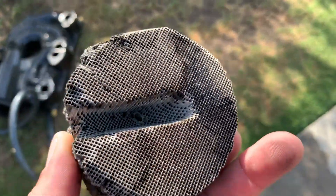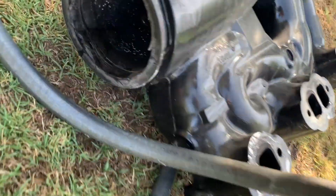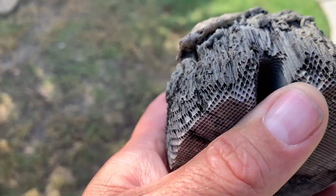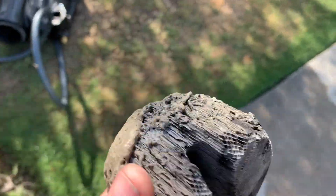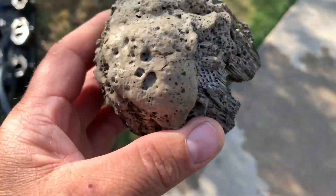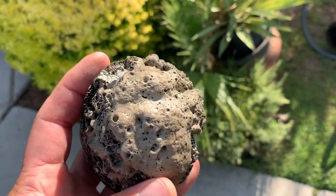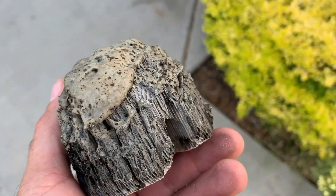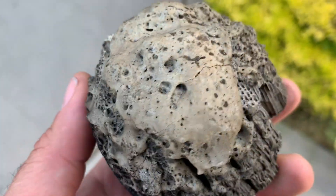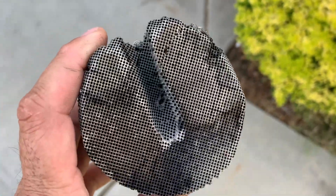This thing right here came flying out of the exhaust and luckily got caught on the O2 sensor. This is the cap — the element inside the cat. I think they sell these as replacements. Something happened — maybe water got on there — and it definitely did damage. Thankfully they caught it when I swapped the manifolds. Make sure you check these too, because they can really cut your horsepower way down.